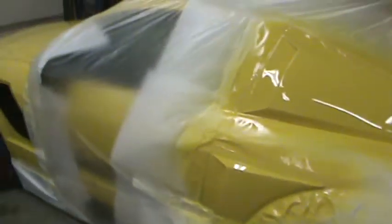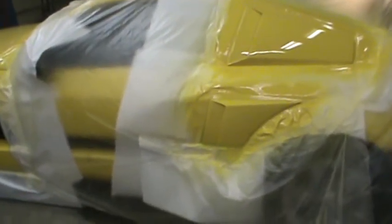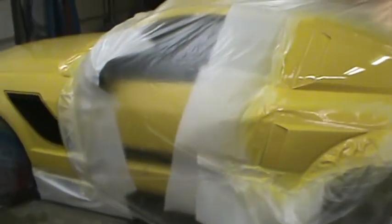But there we go. I think I'm going to hit those one more time since I got the clear in there, and hopefully that'll help those little rough areas. And if we have to hit them with a piece of sandpaper, we'll have plenty of clear on there, and we'll just give them a little touch up if that's needed. But I'll tell you, this 2-to-1 high solids clear, it flows really nice even with the accelerator in it. And a lot of times you can get by with a little boo-boo like that. We're not Joe Perfect here. You know, we got trash in our paint,